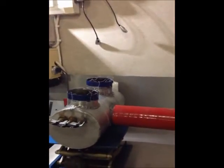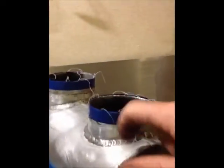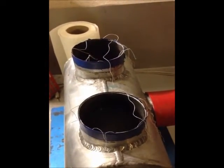Today's experiment is to see whether there's lots of biased airflow on my plenum for the TBR. This is the tank that sits on top of the engine. I've put dainty little bits of string around it so that it can see which way the air is flowing.